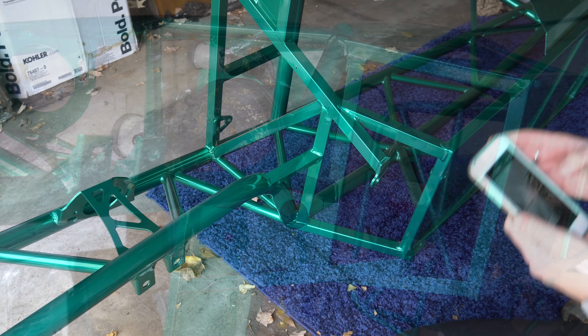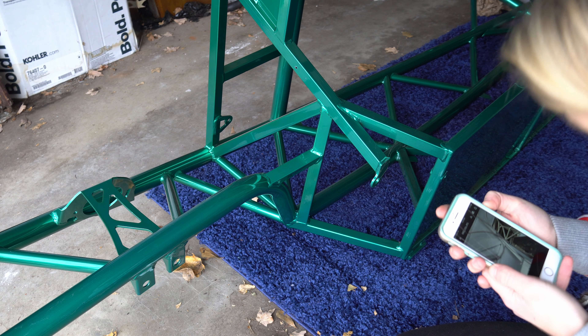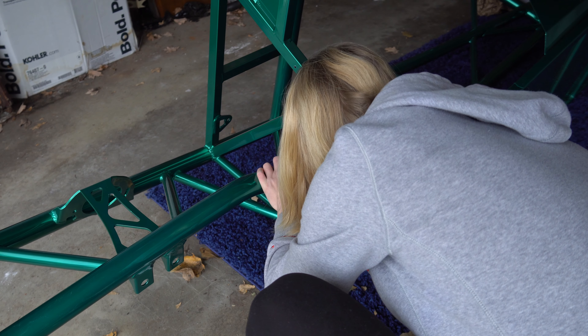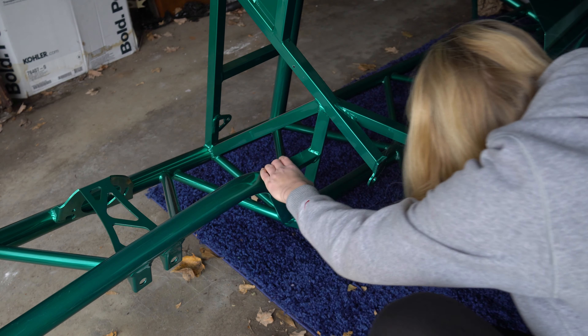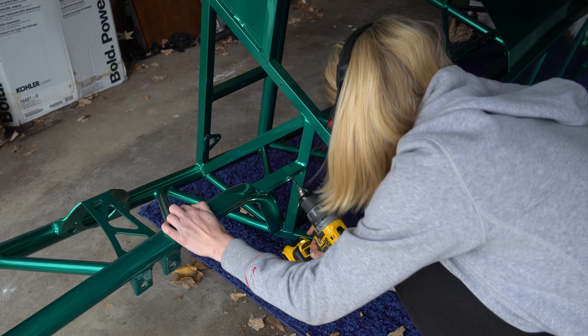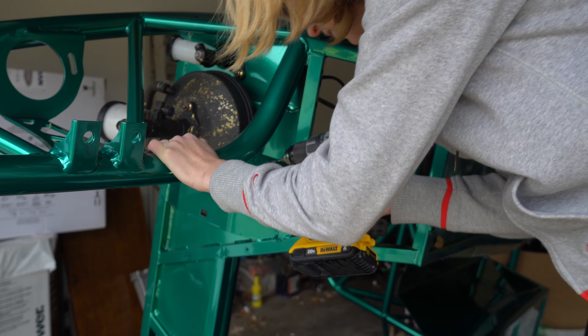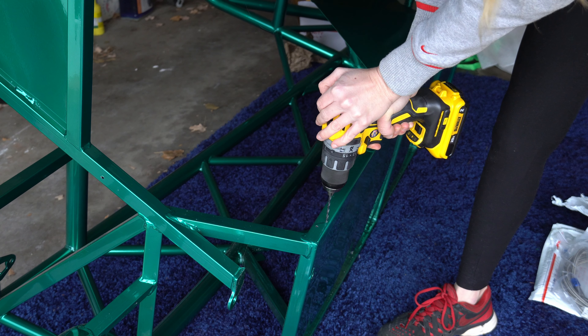Otherwise I would have been clueless. I've got some hot tips from Trevor — thank you, appreciate it. So I'm trying to go through these in a little bit of detail so you know where to place all of your mounting locations. For example, the one I'm working on right here should be for your passenger side front brake line. You'll drill out the location so you can get in there easier later. And this one here should be for your driver's side front brake line. So now we drill.